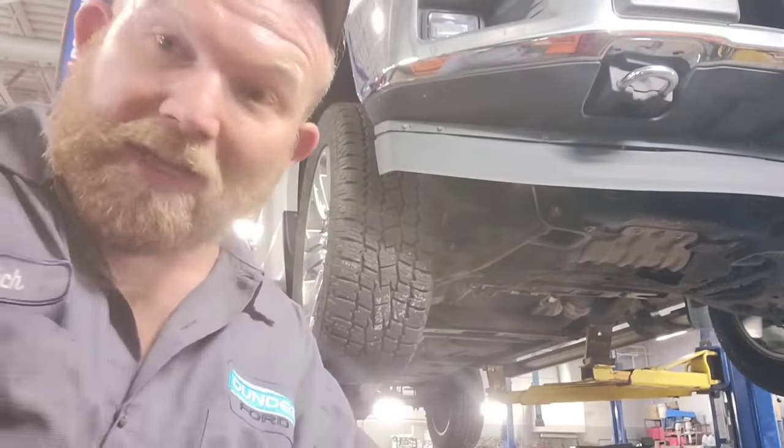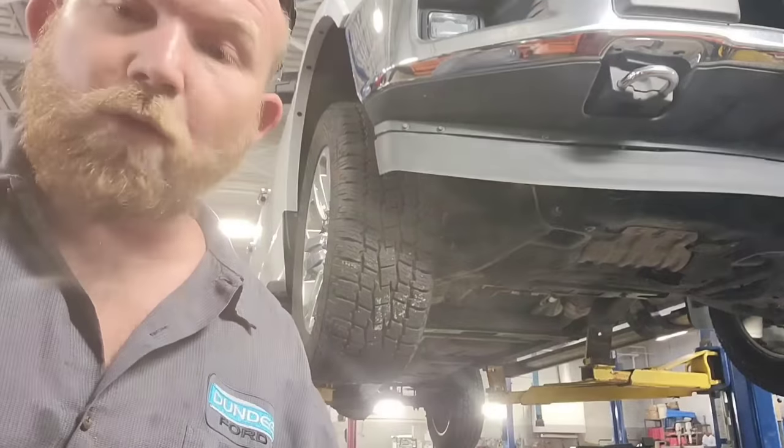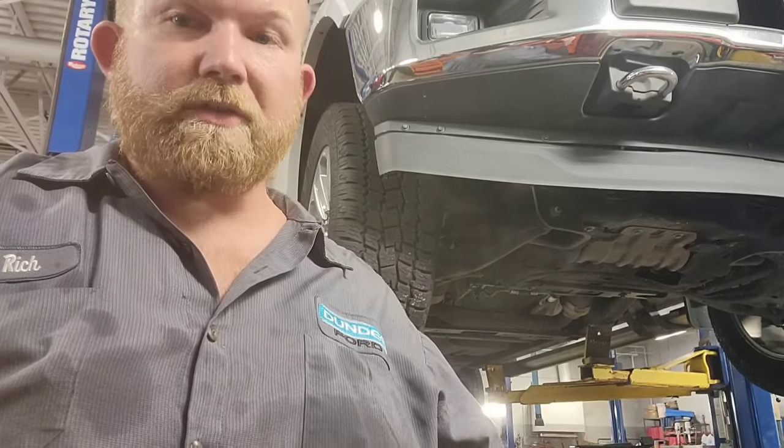Essentially, that's your pan drop and filter change. I was actually wrong on the mileage — this only has 49,000 miles, which is why everything looks so good. I've preached a lot about servicing these transmissions, the 10R60s and 10R80s, at 50,000 miles or much sooner. This customer, who is a subscriber, took heed to my advice — that's why the fluid still looks kind of good and it's just starting to show a little bit of metal on the magnet. It's the perfect time to get it in while you're ahead of schedule instead of leaving lifetime fluid in it.